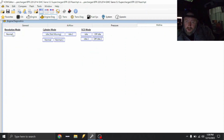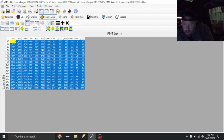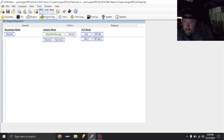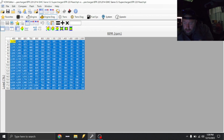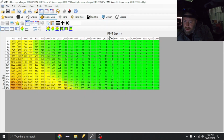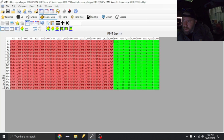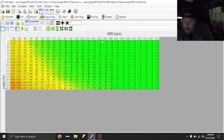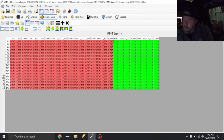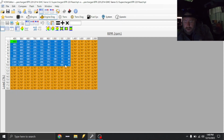Misfire, for right now, we're just gonna max these out. Now what I will do is once I am done, I will dial these in to where they will still function as good as possible with a camshaft. Some guys will just max these out and just leave them alone. Now I just do from 3000 down. But realistically, this is a timer and it's basically how long the ECU takes before it triggers a misfire counter. So you can actually increase it by, you know, basically percentages.